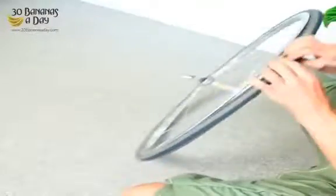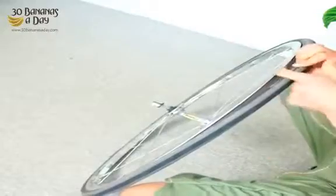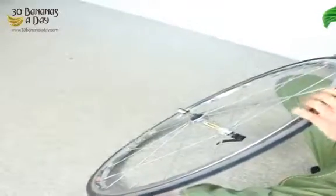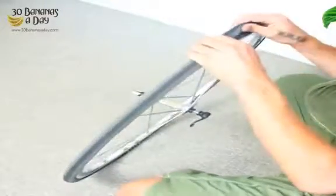It takes a bit extra 30 seconds, but it gives you a lot of safety. It gives you a lot of security on the downhills that your tyre's not going to burst, or it's not going to burst in the next 5 minutes and you have to fix it again. And sometimes the tube gets caught near the valve and doesn't bead properly, so we just push it up and just give it a jiggle. Never use force. Always use technique. Always use patience. And now it's ready to roll.